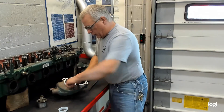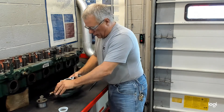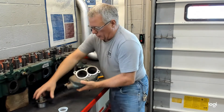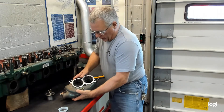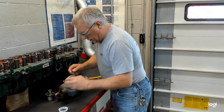You want to clean with some Scotch-Brite the inside bore so that it's nice and smooth, and also the very base of it — that's where the thermostat will bottom out again — so make sure that's all clean. This is the only time you can really get into it, before we put the new seal in. Nothing will go on the seal itself.